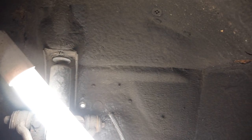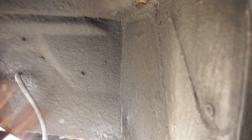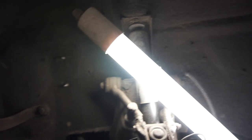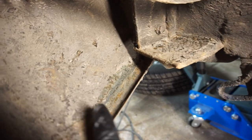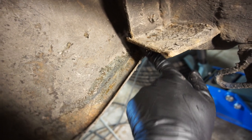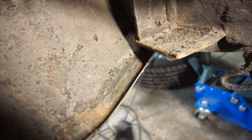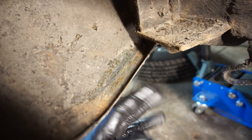I found a little bit of surface rust here where some of the underseal has let go. Otherwise the underseal on this car is in really really good shape, so we're just doing a freshen-up job. If this were a freshly restored car with no underseal, you could skip the steps of getting rid of rust and preparing the area. But if you have an old car like this that's been undersealed before, these steps are definitely worth doing.